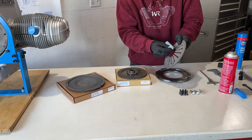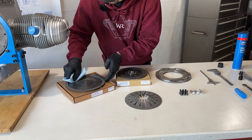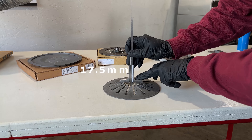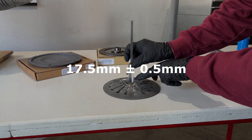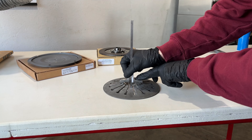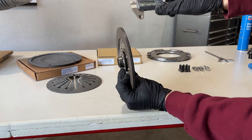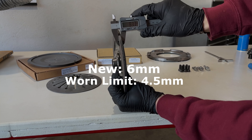After revealing all these brand new parts, it's time for the assembly process and along the way I'll share some tips. First, I'll wear nitrile gloves to clean all clutch assembly parts using brake cleaner and a regular shop towel. The purpose of this cleaning is to remove the anti-corrosion coating applied to the parts before shipping, ensuring proper functionality.